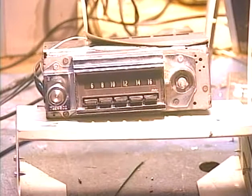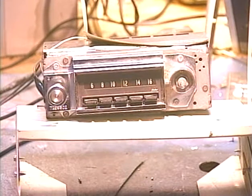The FMC also offers a line input, and since it's a mono radio with a mono amplifier, you'll only get one channel. We do combine both channels with the AUX input, but obviously the radio only has one amplifier so it can only reproduce one channel of sound. When you're using an auxiliary input with a mono amplifier, the music may sound a little bit weird on some songs.